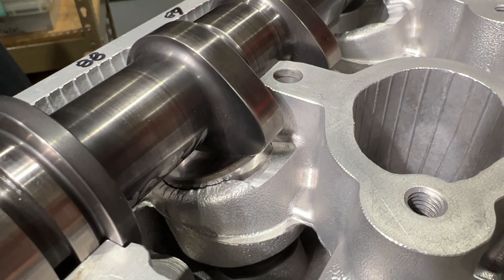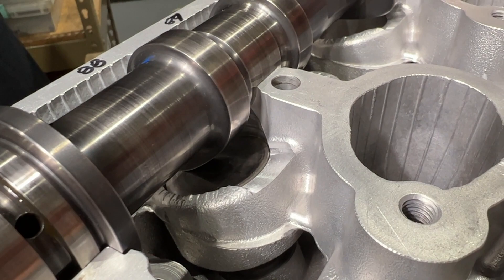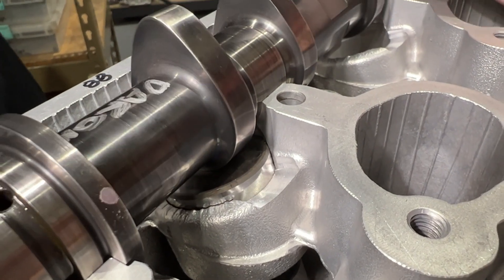There's actually no hardness call-out for a manufacturer to know how hard their camshaft should be, because these parts are designed to slide. They slide against the rocker, they slide against a lifter or what have you — and when they don't slide, they die.